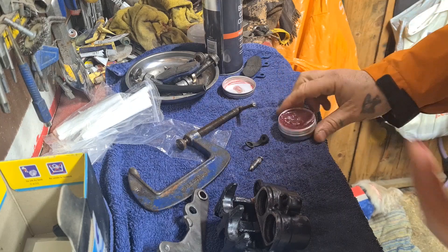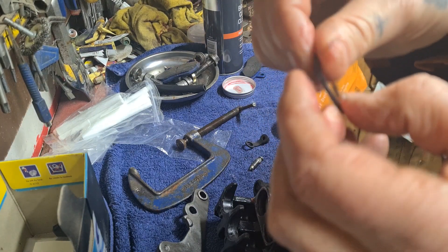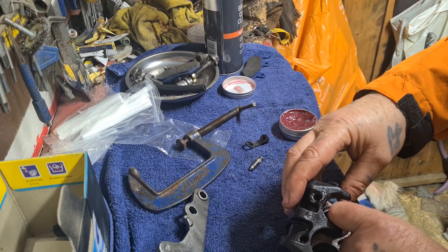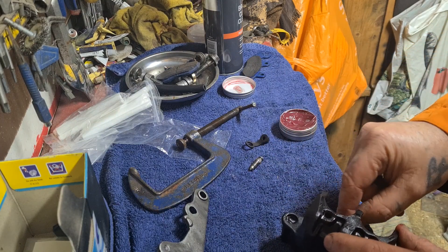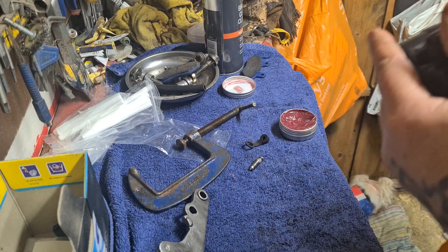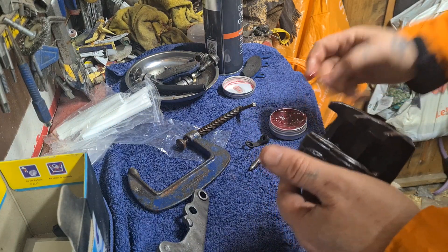Which is not much use, because they need to be sat right so that when the piston moves in and out it's a smooth movement — it's not catching. If it's not sat in the channels right, it might more than likely rub on the piston and maybe not be as efficient. You can rub your finger around and just feel if they're sat in — you can tell when they've gone in, they just pop right in.